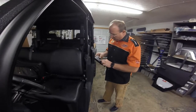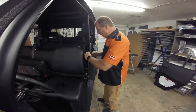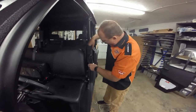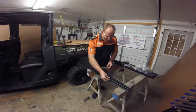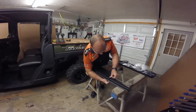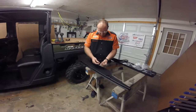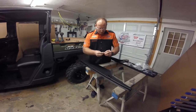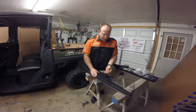Before putting the jam up, get the bracket that comes with the X door — you'll notice it has an X cut in it. Slide it right underneath these bolts and run them down, setting it about midways of the slot, just enough to hold it in place. On the lower hinge, use the five-eighths long quarter-inch screw again in the lower hole with a flat washer, lock washer, and nut — run it up with your finger. The hole on top that's in line with the rest uses the one-inch long screw from the bag with your powder coat and brackets. Get the flat washer, lock washer, and nut started, but leave it barely started because the bracket will also go on that bolt and you'll pull it all together later.